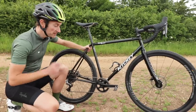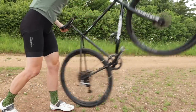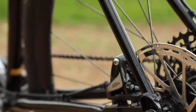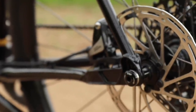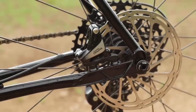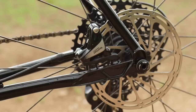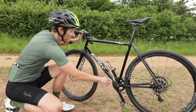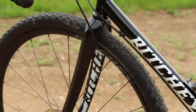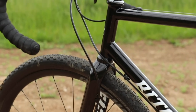The other key detail on this bike is disc brakes — I'll just spin the bike around to show you. To bring it into the modern era, it's now running 12mm thru-axles front and rear with flat mount disc brakes. They've made these really beautiful forged dropouts for the flat mount adapter to fit to the frame — it's really nicely done. There's clean cable routing on the chainstay and up the downtube, and on the fork it's external routing as well using the regular flat mount adapter from Shimano.